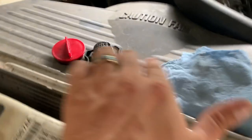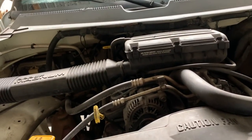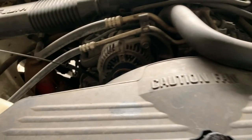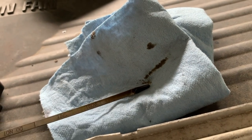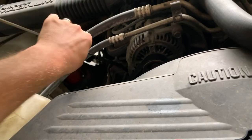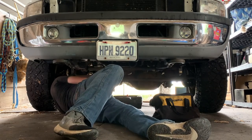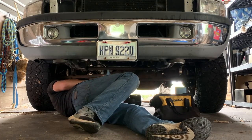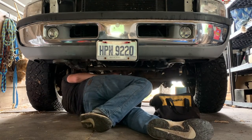Here's what it looks like under the hood — it's actually fairly clean. I checked the trans fluid and it's actually good, in the okay line, and the fluid is a nice reddish or pinkish color. The engine oil I did check and it's pretty dark — actually pretty black. It needs done. I'm not going to act surprised, I kind of figured it was going to need it. The oil doesn't look as bad as I thought, but it's definitely dark.